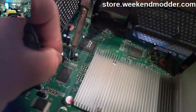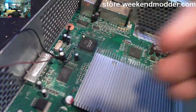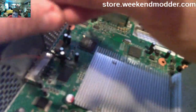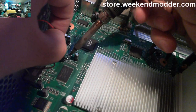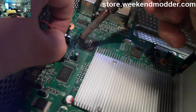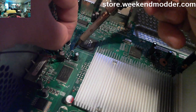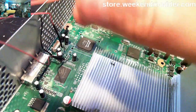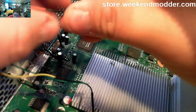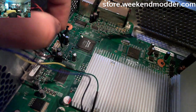So that technique just gets repeated. I get in position, I tap the solder glob with the iron, and then I insert the appropriate color-coded one, referencing back to that diagram we looked at earlier. And then I've also got some kind of helpful little bins in the end, whatever makes sense to you, where you can get comfortable access to the NAND wires. But basically, you're just going to want to follow the install diagram for your FAT console based on that image that we showed earlier.